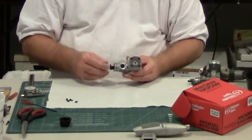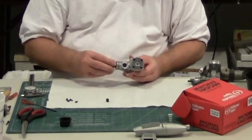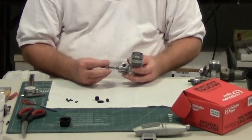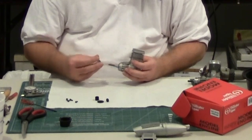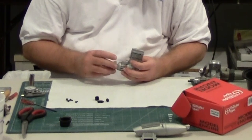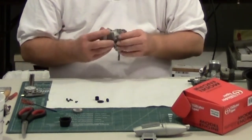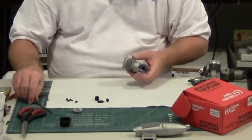I'm going to go ahead and take off the thrust washer and get a look at it. One thing that's different between this one and the old ones is that the old ones used a collet. This one has a flat key to hold it in place, which means you're not going to have trouble getting the thrust washer off. If you're changing bearings or taking the crankshaft out, that makes it less of an issue.